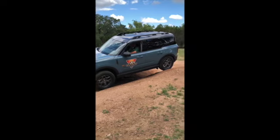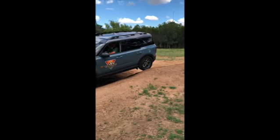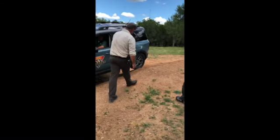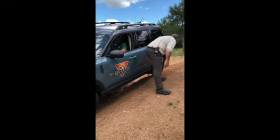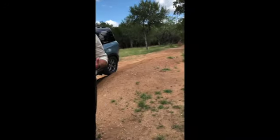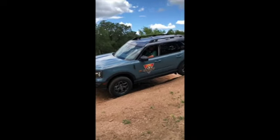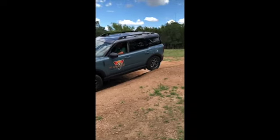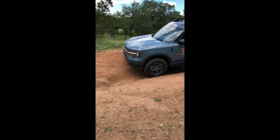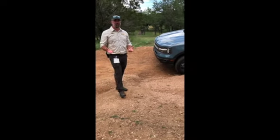And the tire being on the inner wall, that's fine. If you notice where it actually is, there is still tread there. We're on this section of that tire that has tread. That's what it's designed for. But a good point: anytime I'm out and we have some rocks around, we would rather put our tire tread on top of that rock than that sidewall. Because what's the weakest point of our tires? The sidewall. We don't want to stab anything through the sidewall if we can help it.